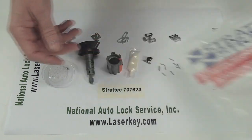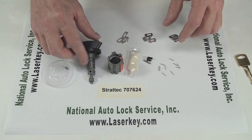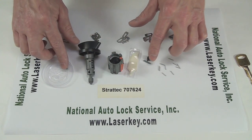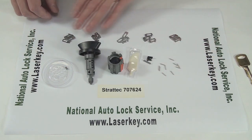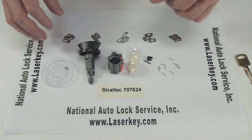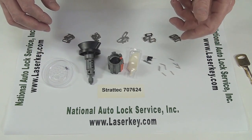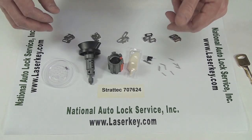It comes as a kit. You get the grease, the lock housing, the lock cylinder, the key buzzer, the detent spring, the tumbler springs, and then five different groups of tumblers — enough to code up any standard Ford in this code series, which is 0001X to 1706X.